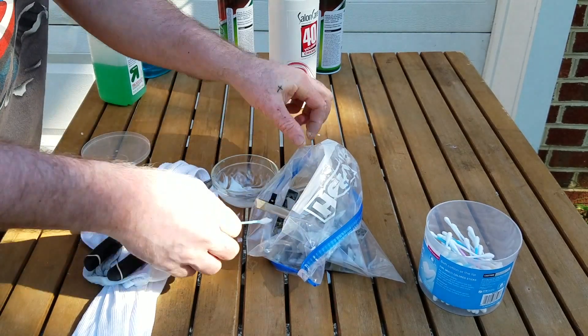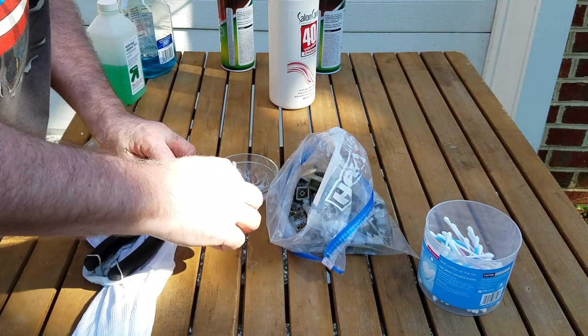Also, if you're doing this during the winter and it's just not going to happen, you can also get an electronic ultraviolet lamp — it'll do the same trick in probably more precise hours. If you'll remember, I placed the space bar in the same bag with the other keys. Unfortunately, this resulted in an uneven exposure. For your own project, I'd recommend placing it in its own individual bag. Also please note that the space bar is actually a different color than the keys — the keys are a gray color, but the space bar is a kind of beige. For this particular project, I sanded down the uneven exposure to get down to the original plastic, and then gave it a cleanup with some plastic polish.